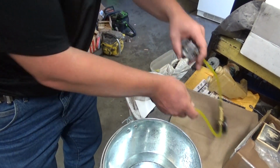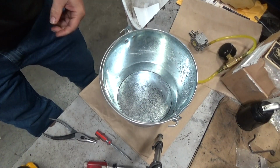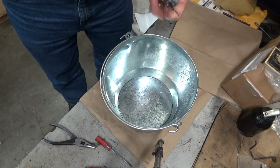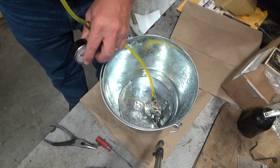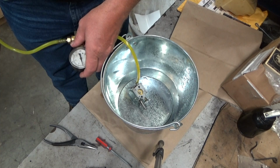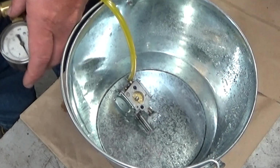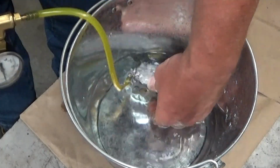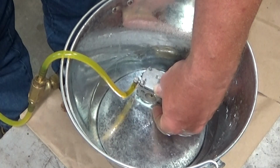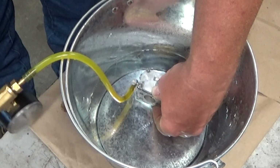And I'll re-angle the camera. Alright, I see a view of the bucket there, I think, in the viewfinder. So, let's submerge this bad boy, let it fill up. Oh, look at that. There's a leak around somewhere. It's actually around the screw itself on this one, and there is a leak at that vent hole cover. Okay.